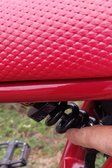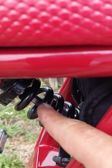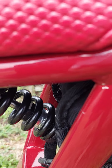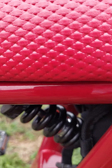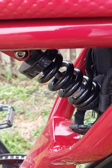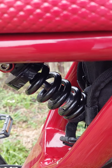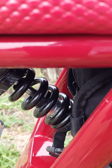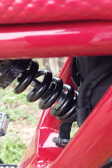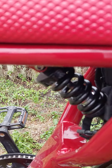On the X48, there's a shaft with a plastic sheath around it, and if that shaft in the center dries out, every time you hit a bump it's going to make a noise and drive you crazy. So I cut that plastic off around there so I could squirt a little WD-40 on that shaft, and after I did that — no more noise. It's quiet. I couldn't believe how much difference that made just in my riding experience.